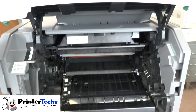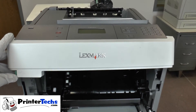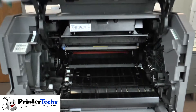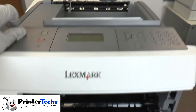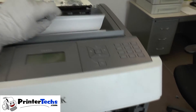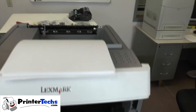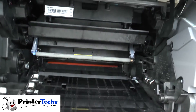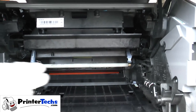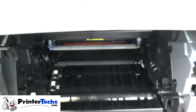You can't see the charge roller unless you lower the toner lid on top. As you lower the toner lid, you can see the charge roller drop down. That's why I have the paper on top here — I'm just going to move that forward, and that allows the toner lid to stay down about halfway, so I have an extra hand free to remove the charge roller.